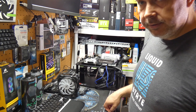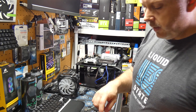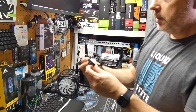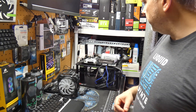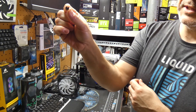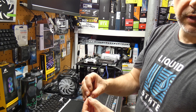Now you've got basically two plates: one for mounting the cooler above the board and a back plate. The way they've done the back plate is you've got holes with little dots. There are three positions that the little pins can push through, and the little dots hold them in place. The socket I've got - which is the 1151 - goes in the middle one. There's a tiny little gap, and what happens is the pin goes through the top, then the rubber grommet goes through and lines up, and the little plastic piece pushes through the gap to hold it in place.